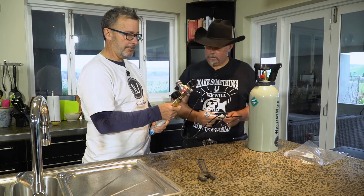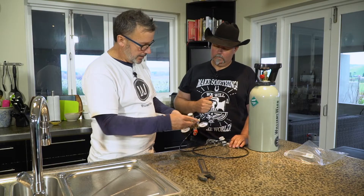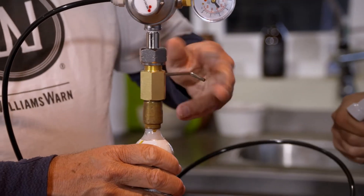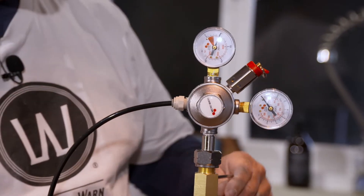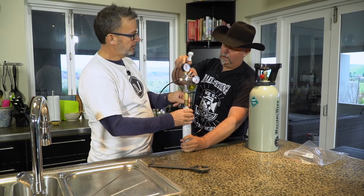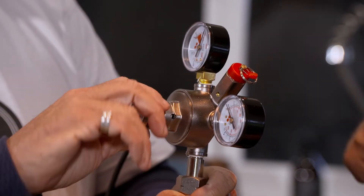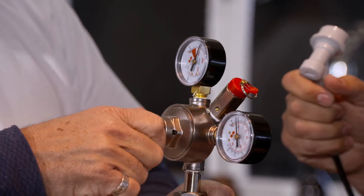So how do I set this SodaStream model up with a regulator? We're going to unwind this and effectively disengage the regulator. Most importantly, we're going to turn this on. Allen key into the side here and you'll see as we engage the gas — the gas has come on. That gauge shows you how much pressure is left in the cylinder. This little meter is going to show you what the pressure is on the other side. And the way you adjust this one is with this little knob here — you can see as I'm turning that, we're moving it up and down.